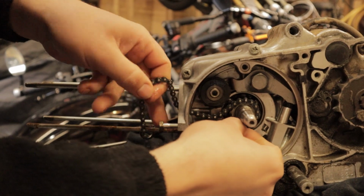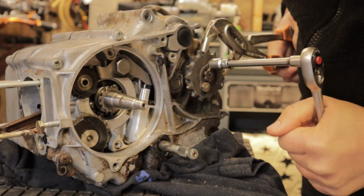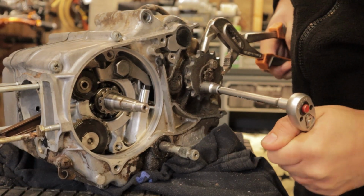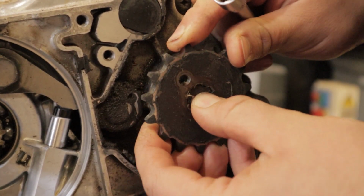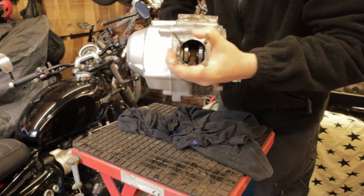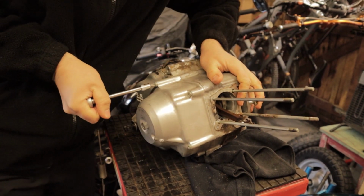At this point, my thoughts for this bike are, it was very low mileage, 1800 miles. I'm assuming that is correct, but it looks like it's had a pretty hard life. It looks like oil sat in the engine, be that through oil coming up through the rings or the valves in the head leaking, pulling oil back down, or maybe someone putting oil in the fuel thinking it's a two-stroke. Either way, that top end is massively gummed up for a bike with such low miles.